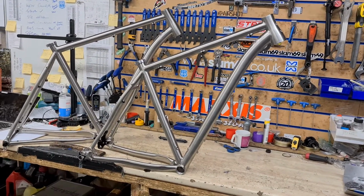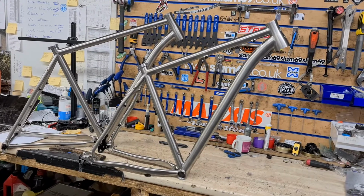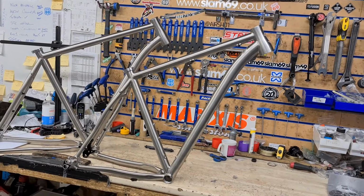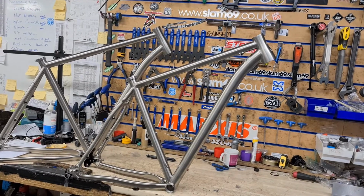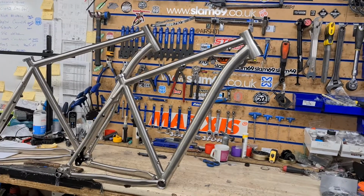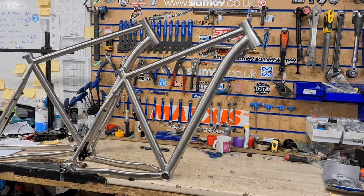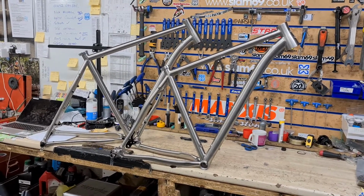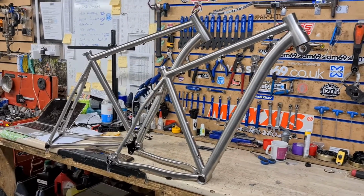That's the idea. But we now offer 3 different rigid carbon forks with the bike, so you can request the Whiskey Boost MTB fork with mounts on the legs, or we also now offer a Kinesis MTB 29er fork, which is slightly shorter for those that want to tweak the head angle back a little bit, because at the moment it's standard at 69, but you can speed it up with a slightly shorter fork. It doesn't alter the geometry that much, but it's a really nice fork, a bit more affordable. And then we also offer, for those that want it, an Enve carbon fork as well. It's not that much more than Whiskey, but it's a beautiful fork.